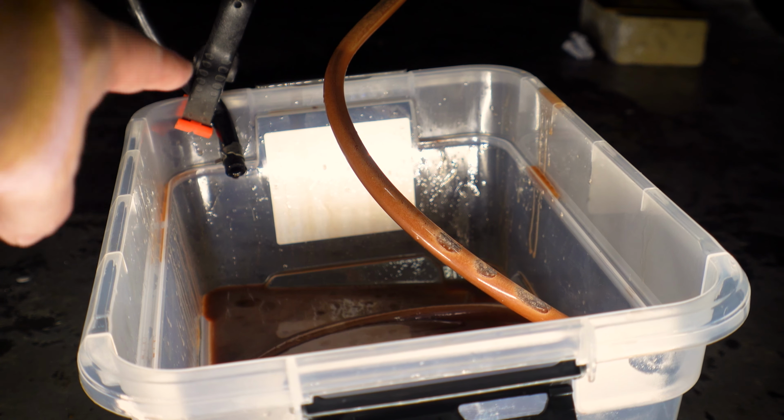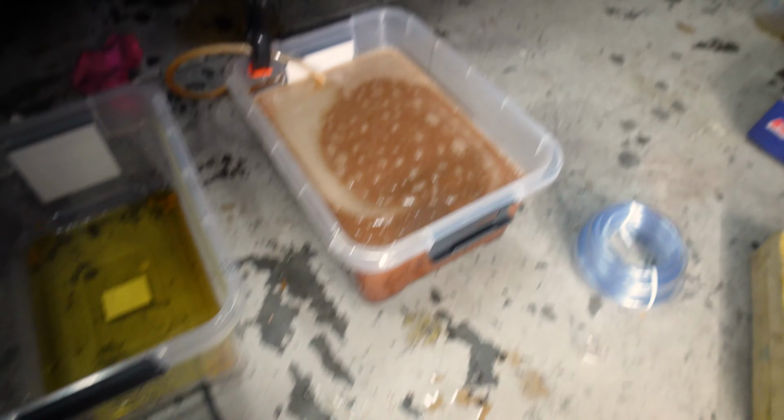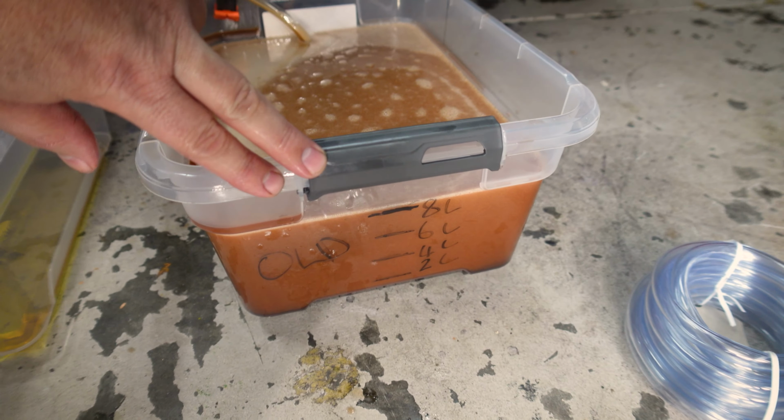One thing is that the fluid coming out got really aerated. I'm not sure that's a big deal though. I just let it sit with the new fluid in the trans for about 20 minutes so that it could settle. I ended up taking about 8 liters of fluid out. That's in addition to the 3 we took out before, and we put 11 back in total.